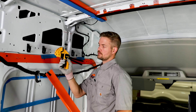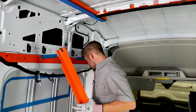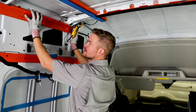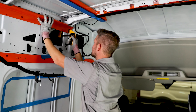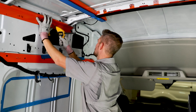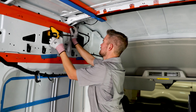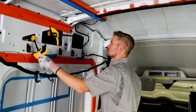Clamps are really helpful especially if you're installing this by yourself — they keep everything exactly where it needs to be and out of the way when you go to drill or rivet. Put it right where our line is. As you crimp down on a clamp it will drift, so make sure you correct it before you actually drill the hole.